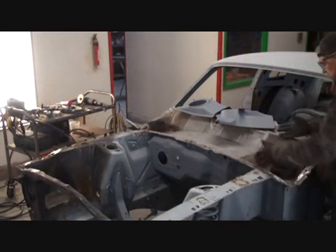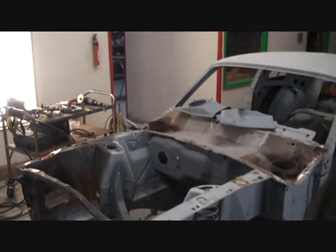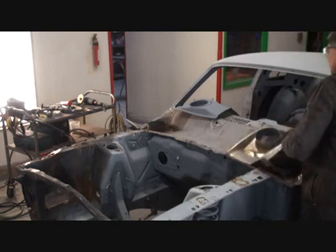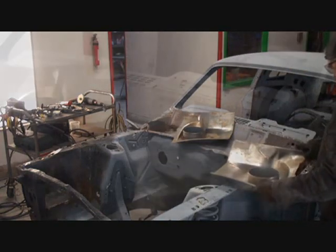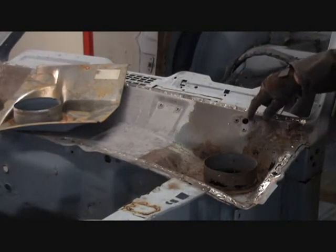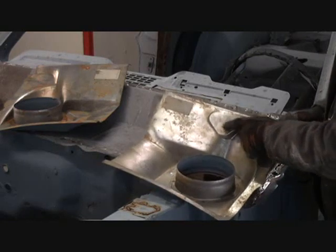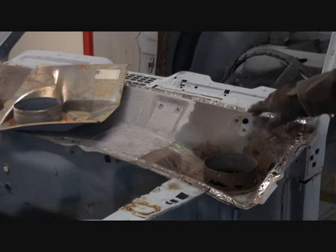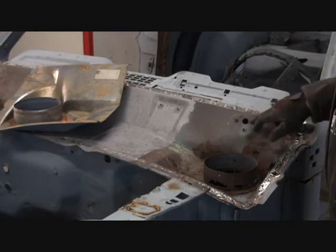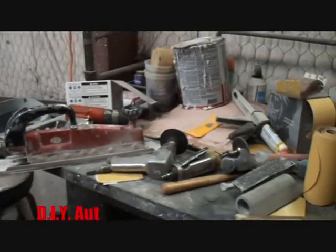Due to the fact that it's going to be hard to get up in there and prime those later, now that we've got the outer cowl panel removed, we've revealed our rot and rust problems. The next thing we need to do is prepare to install the new panels. I just noticed something on these panels right here which I'm really not happy with — this is where our wiper shaft comes up through the car. On this panel, all we have is a stamped-out area, so we've got to be very, very precise on mounting this. I'll show you how to drill the exact holes it takes, and then we'll either use these nuts or replace them with new ones.